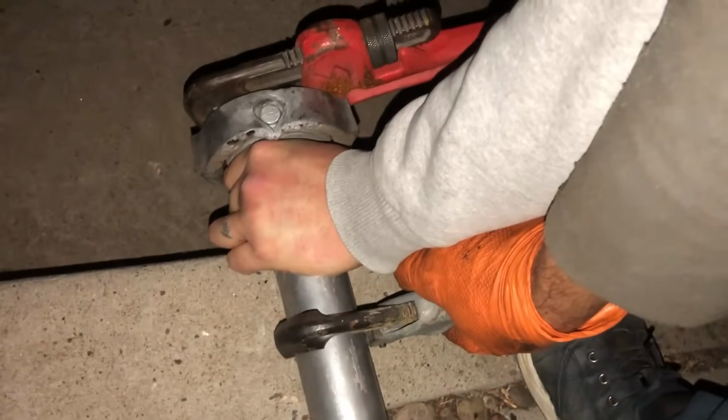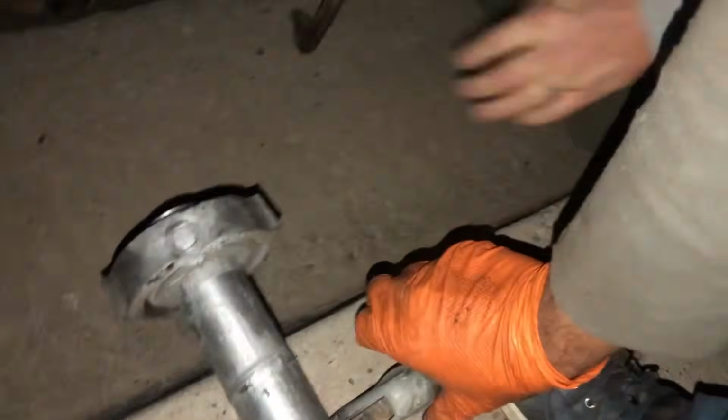And I think the clutch, you know, sometimes when you're putting a transmission in, it's really tight and it's just not happy with the mating of the bell housing to the engine. What seemed to help me was getting the clutch cable on, and then I could disengage the clutch, and that sort of loosened up everything and helped kind of settle some of the tension.